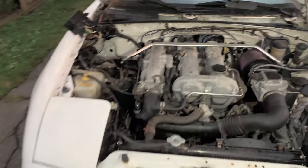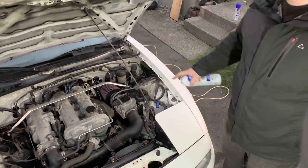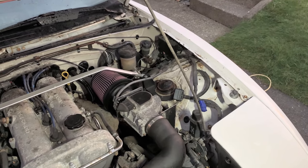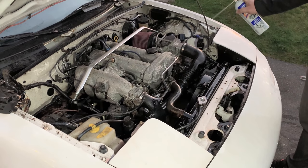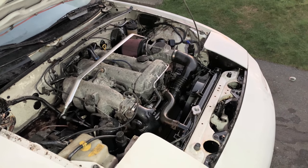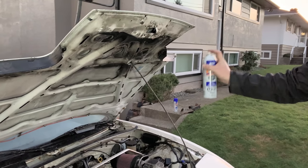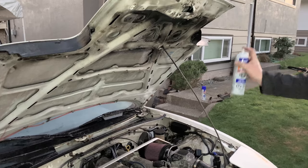Keep the degreaser away from spark plug wires, main harness connections, and the air filter. But anything body-panel-wise and sealed components — like the brake fluid reservoir and clutch master — you can spray those. We're only doing this right now because there was evidence of a rodent. Once an engine bay has been really well cleaned once, most debris will just wipe off a clean surface. It's engine grime that makes things adhere, so once the grime is gone it's a lot easier to maintain.